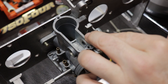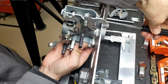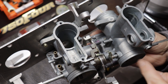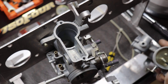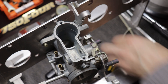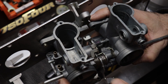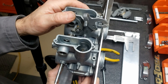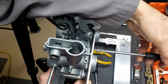Here I'm just visually going over everything with a mental checklist before proceeding to bolt carburetor number three on. I did have carburetors two and three bolted together just a few minutes before this but I took them apart again because I didn't like the tubing I had in for the vent lines. I realized I needed to take the choke plate out so I could move the shaft over enough to give clearance to get the spring where it needed to be. I pushed the choke linkage over, reconnected all the hoses, and then was able to bolt the carburetors back up to the plate with all the fuel lines attached.